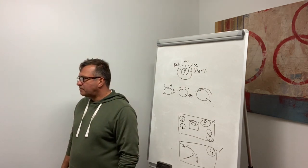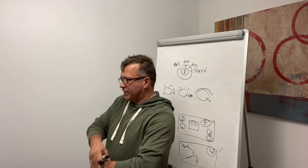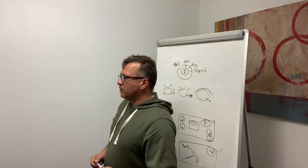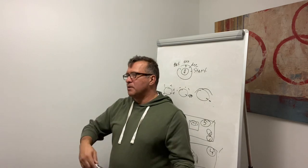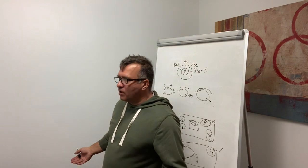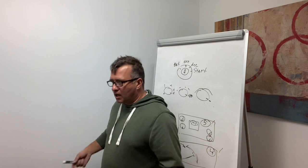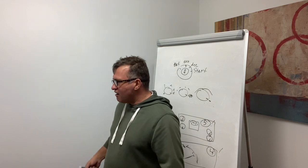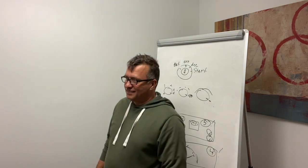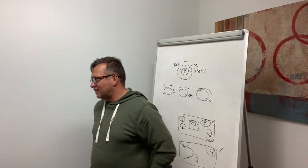1200 RPM. Some examiners say, okay, wait, do more than 1200. It's okay. If you do more RPM, what's going to happen? It will build up pressure faster. On one hand, but on the other hand, it will be noisy, it will be loud. With the revving engine, it can be very loud. Remember, it's a 15 liter engine. You can hear the sneeze. So do 1200. Well, if you're getting instructions, you better do it. It's your test.